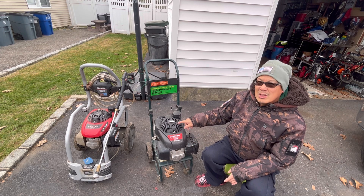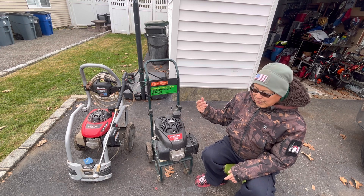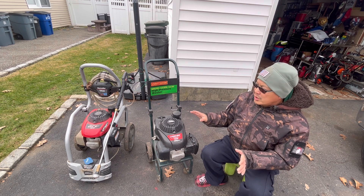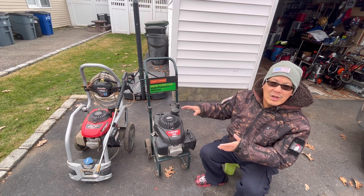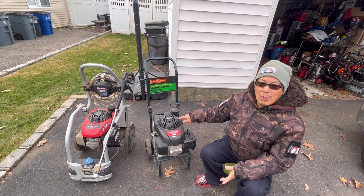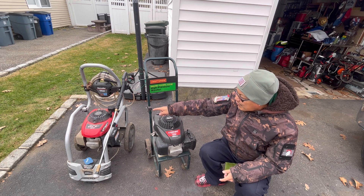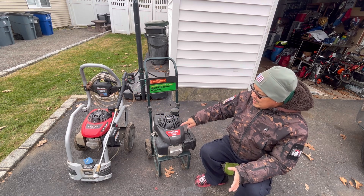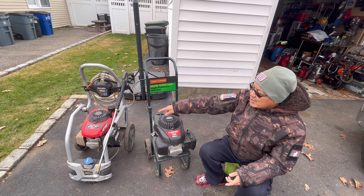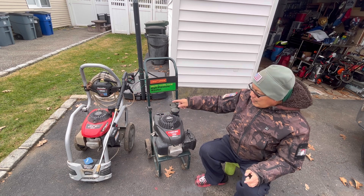It says on the sticker: 21-inch push mower from Troy-Built, side discharge, rear bag. This is actually what I need because it's a lawnmower engine and I need one for a couple of decks in preparation for next spring. I was thinking of making one good pressure washer engine out of the two, but here I actually have a lawnmower engine I need. My inclination is to take the flywheel off the 190, figure out why that one has no compression, and use that flywheel for this one.